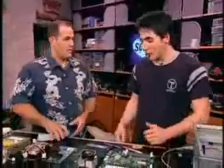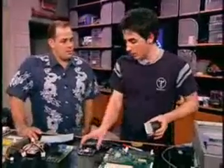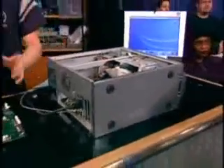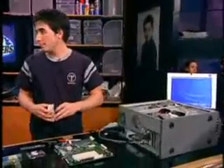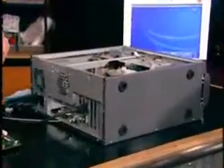So this is a single one gigahertz processor motherboard. Apple doesn't even sell a single CPU machine anymore. What would happen if you built a dual CPU machine? That's going to be really tricky — you're going to have to get a bigger heat sink. But you can do it. They do sell dual processor motherboards, and you can pick up another Sonnet one gigahertz chip. It would work fine, but you really have to focus on cooling and make sure you keep those CPUs cool. Are you going to save any money over a new G4? You might save a few bucks, but you're going to put a lot of time and energy into it — so it all depends on how much your time is worth.